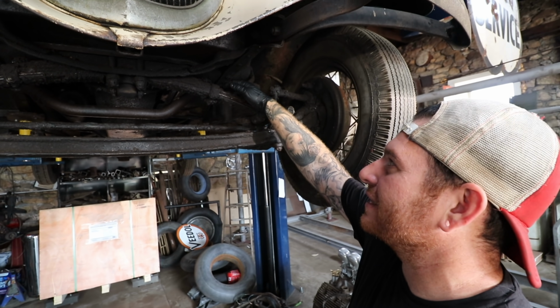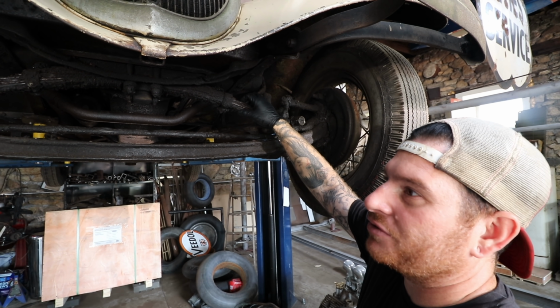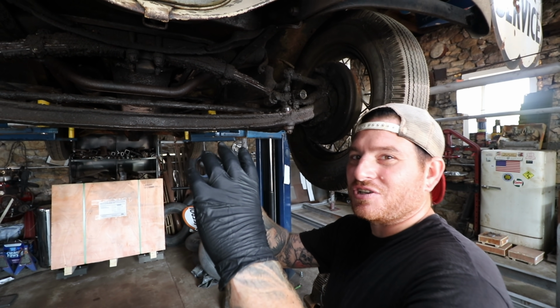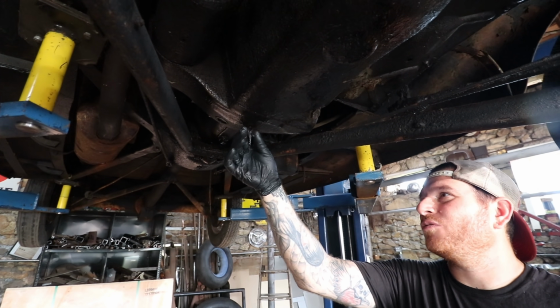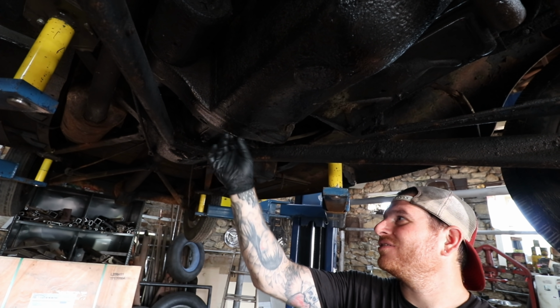He was also putting oil in the cylinders. Yeah, the owner that we purchased this car from was oiling the cylinders regularly. So when we loaded this on the trailer, the oil pan was so overfilled that it was just dumping out the rear main seal and out this factory weep hole that Ford put in the bell housing, with a little cotter pin and some hay on there.